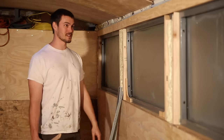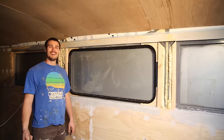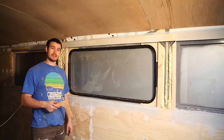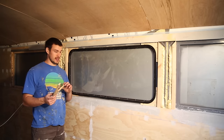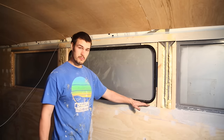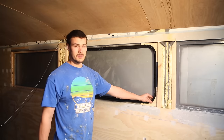That's how we're going to be doing this. We're going to continue working so we can show you the finished product. Let's check out the progress with prepping for the window installation. We've got the little corner pieces described earlier — I had made the mistake of making the inside wood portion square instead of having a radius on each corner, which is needed for the clamp ring to have something to grab.